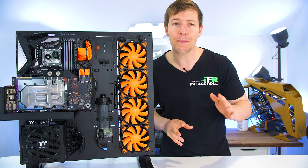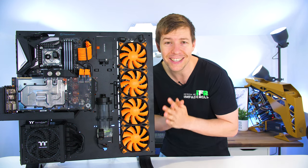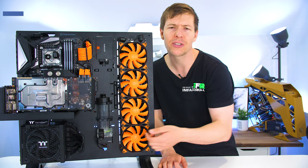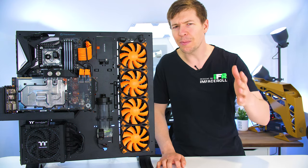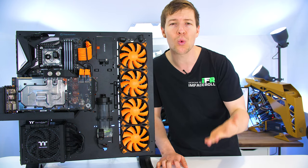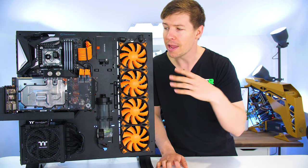All of the water cooling gear was also purchased without taking into account draining the system. There was no drain valve, so I had to throw a Thermaltake fitting down the bottom, which had an extra port on it, so that it makes it easier to drain the system when it comes time for that. I did a bit of research, and this water block from EK Water Blocks actually works in reverse as well, with little to no restrictions and compromises in performance.